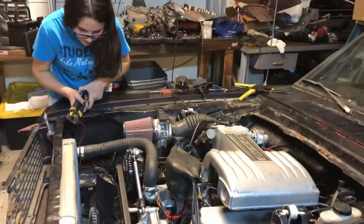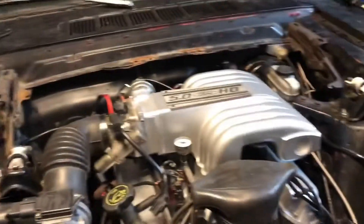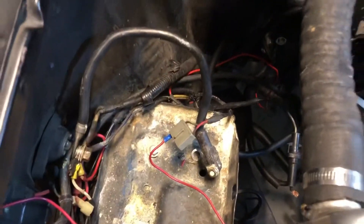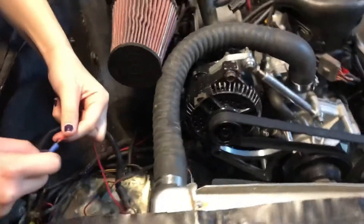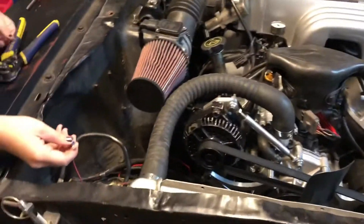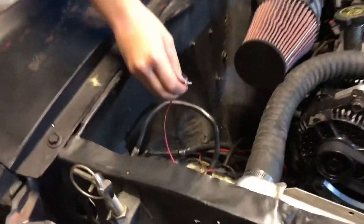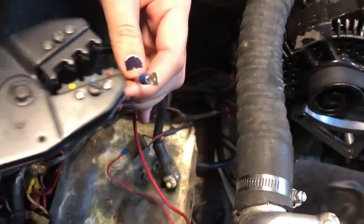It's kind of hard to see, but I'll show you later when I get it out there — most of it's protected, still working on that. My lovely assistant, my daughter Julia, is helping me with today's wiring job. I may decide in the future to eliminate that spade connector — a lot of this wiring I'm gonna come through and clean up after I get the thing running. I don't want to bundle everything up just to find out I need to take it all apart. So step one is just to get everything wired up right — we're following the diagrams for Crane ignition wiring that I found on their website and just doing simple splices.